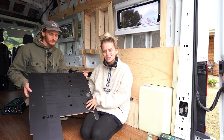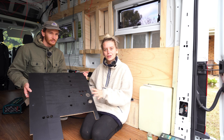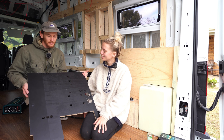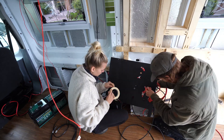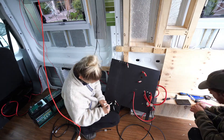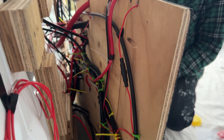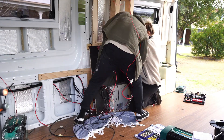So we finished our mounting panel — made it out of plywood, cut out all the different sized holes for the cables to run through, and painted it black so it looks a bit neater and cleaner. Now we just have to mount it to the framing, pull all the cables through, and mount the components to it. We started pulling all our cables through the panel and labeled each cable as we went so we knew what each one was. We also organized the back of the panel using P clips and zip ties, as there were around 80 cables in total and we wanted to make sure we didn't drill any screws into them.